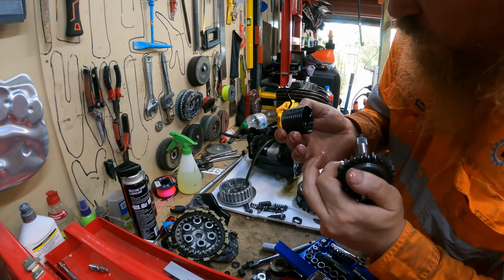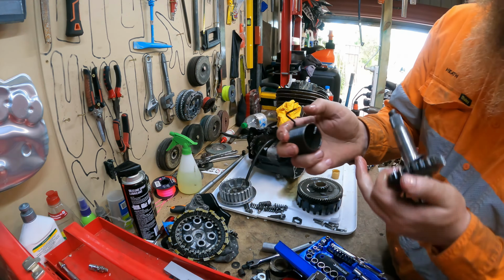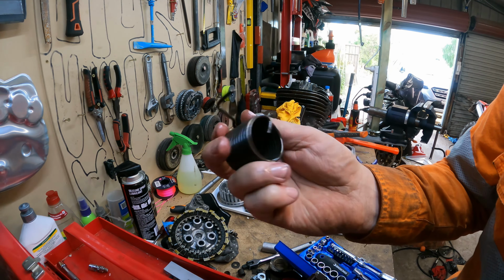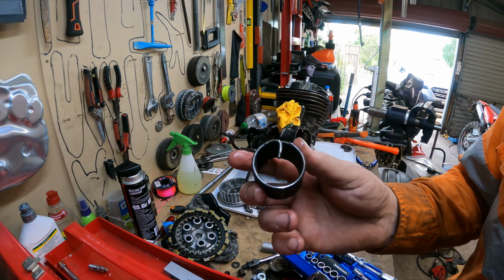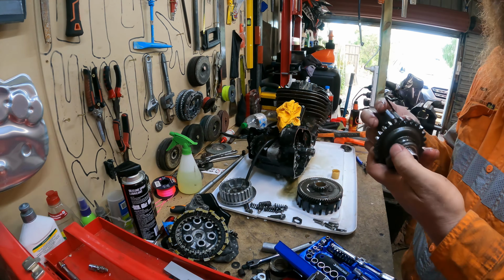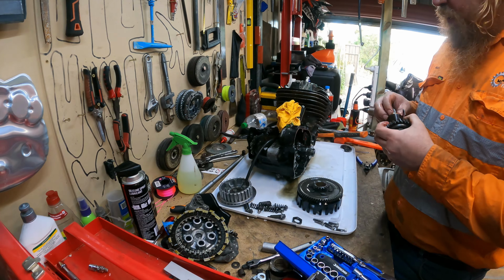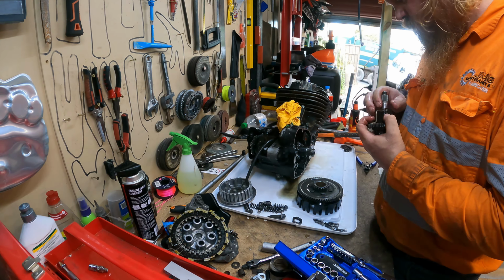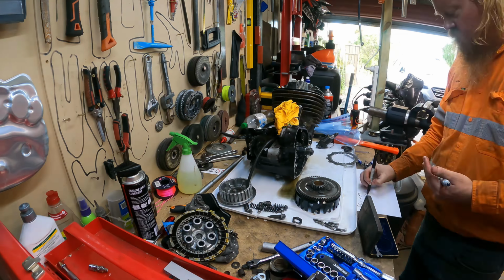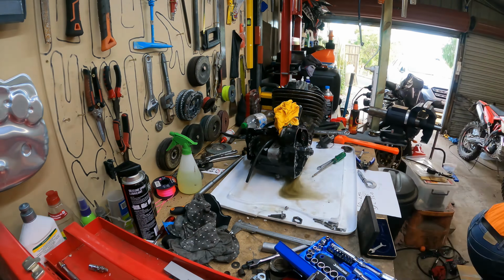Ooh. Oh, okay. So we're gonna replace this spring. This can be a spare. I don't think it's terrible, but that little bit of burr there. I don't know if you can see it. I don't like it. So I've got some spare kick springs. Let's pop that back together for the time being. Doing a quick little bit of a QA on these parts here, and everything checked out except for the clutch springs, which I'll replace.